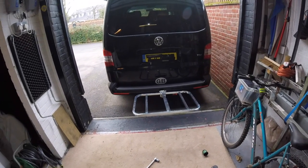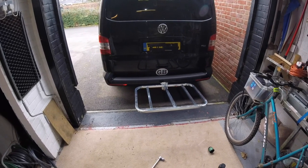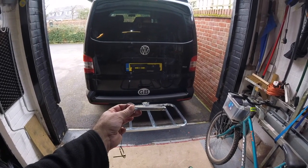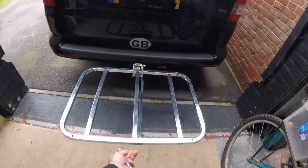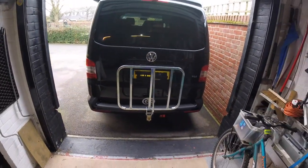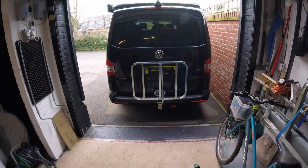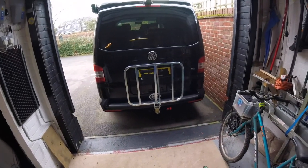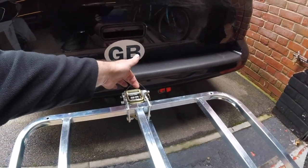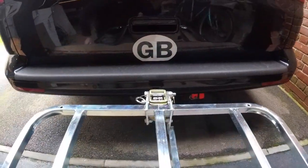The advantage with the Backrack G3 is that if you are intending to have it fitted to your tow bar but travel with no load on it, it can in fact be hinged out of the way. You remove the safety pin which passes through the clamshell and then the rack is simply hinged up, and the pin is reinserted and it's safe to travel like that. It just means if you're doing a journey where you will only have a load one way — when you're perhaps going to collect something — you don't need to have the rack down when it's empty. The retaining pin now reinstalled; as you can see the rack is ready to take a load. It simply passes through the clamshell and has a safety locking ring on the other side.